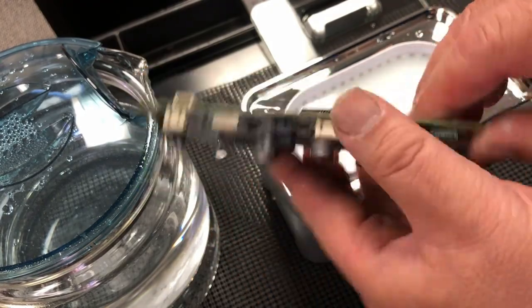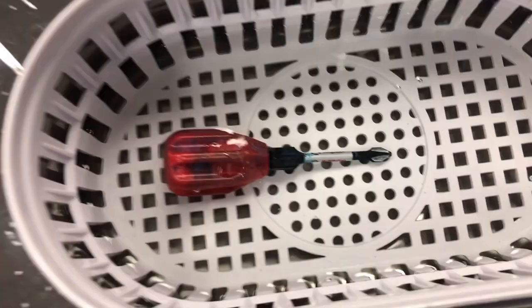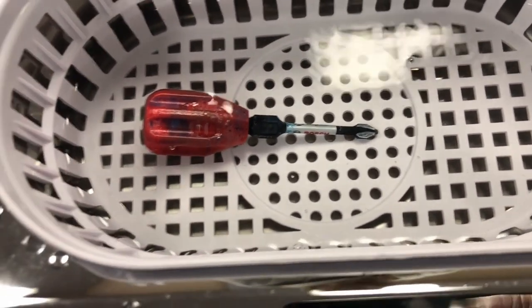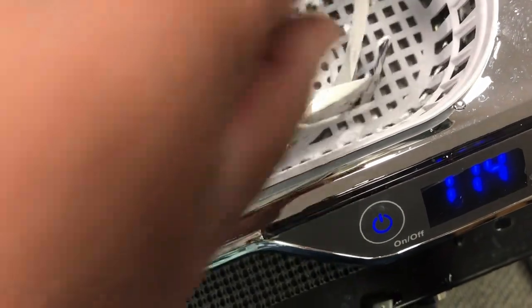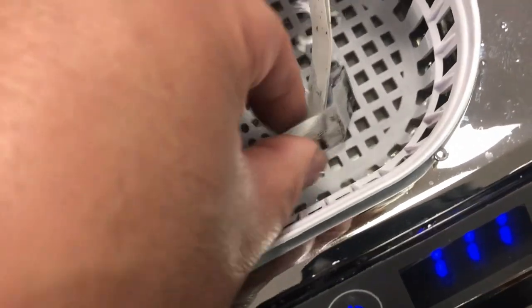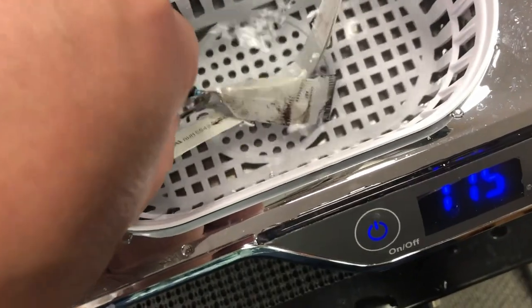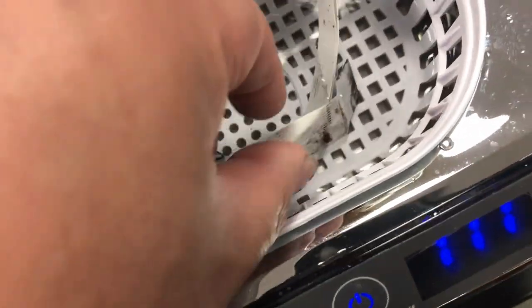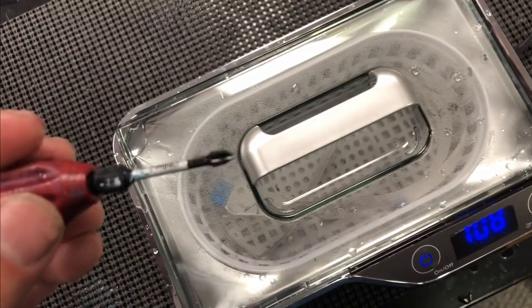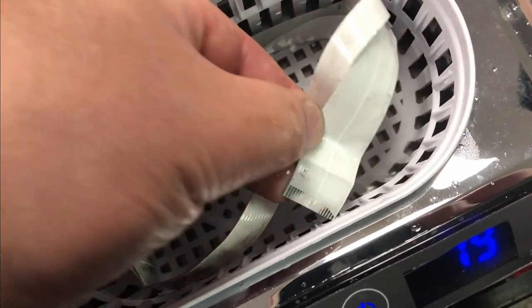Here we've got a really clean board. I routinely clean all my tools and the FFC cables. Those cables are really easy to get contaminated by ink, and if I put in a contaminated cable near the printhead, it's going to fry the printhead. You can see the little particles already getting knocked out by the ultrasonic cleaner and floating around — that's good.